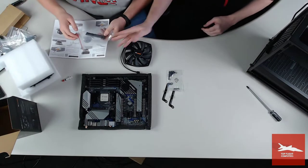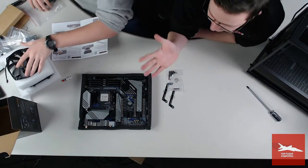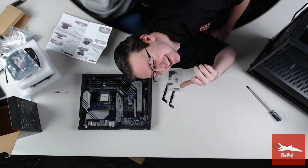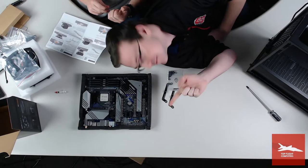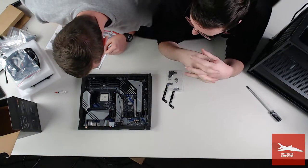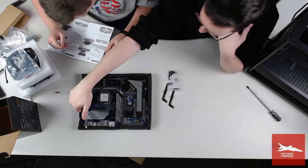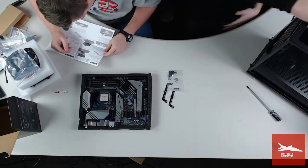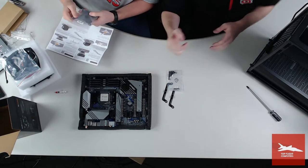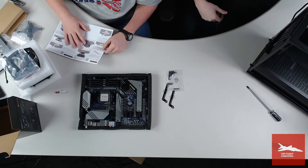So that is going to be for later. We do not need that right now. We're not installing the CPU cooler yet because the Dark Rock 4 is a very, very large CPU cooler, and if you put it all here, you have this big honking piece of metal, it's really hard to access the cables, especially when you get up into the top of the case. Even though, actually, no, you can go ahead and install that, believe it or not, because we have that removable top bay.